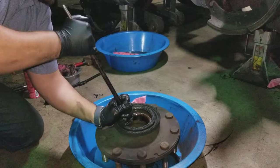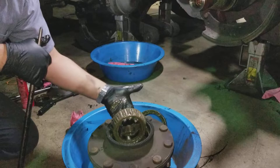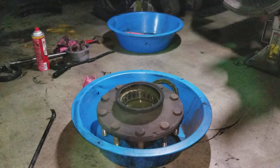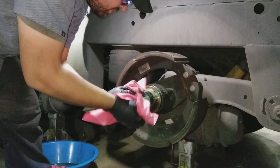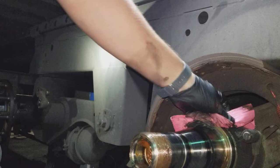Okay, here we go. Now it's coming. Pull your seal. Pull this bearing. Plop this guy out of the back. Grab some more towels. Clean down your axle shaft, get it nice and clean. Just remember, if you have any kind of oil residue left up in the rear, this thing will fail inspection. So wipe off as much as you can.